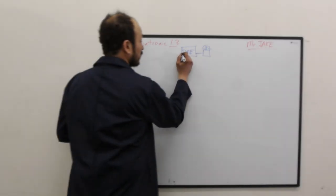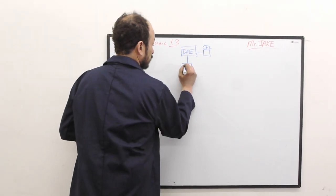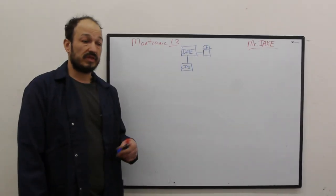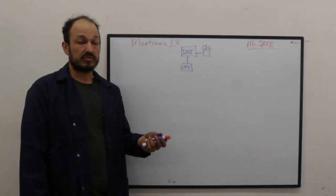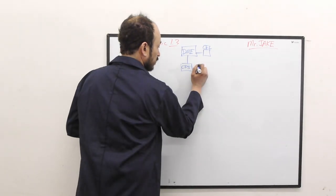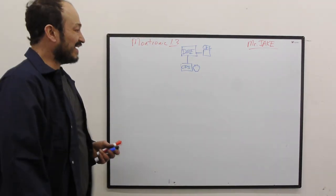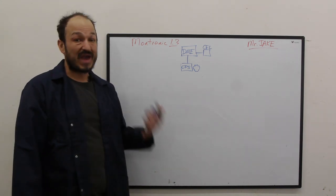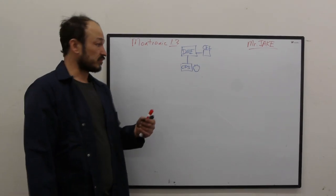So below the DME is our crank position sensor. Very, very important. The crank position sensor lives on the front of the engine. It is a VR type sensor that reads the teeth on a wheel. There's this little wheel going around, and it's got a missing tooth, a really nice wheel there, by the way. The sensor reads the teeth. It tells the DME how fast the engine is spinning. It also has a missing tooth, so it tells it where the engine is.